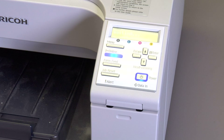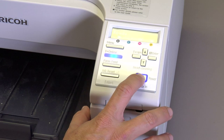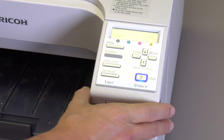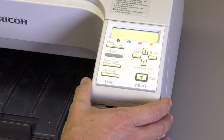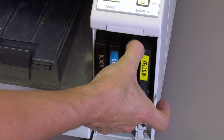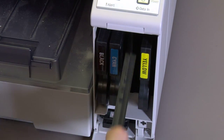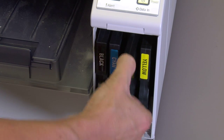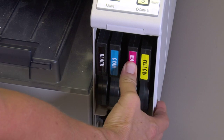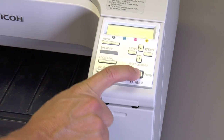If it does, then we're going to repeat the process, starting the second one from the far right — which, coming over one, would be your magenta cartridge — and you'll pull that cartridge out. You're going to power it off, pretending that there is still a 990 error. You're shutting it down as if there's a 990 error, open the bay door, and pull the magenta cartridge out this time — right next to the yellow one. Pull it out, verify there's no damage, place the cartridge back in, snap it in right, make sure you've got a good seal, close the bay door, and turn the power back on. This will prime the line again.